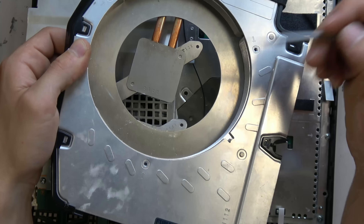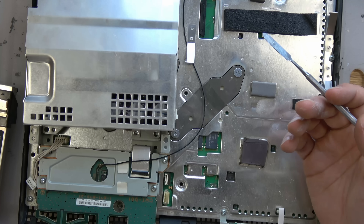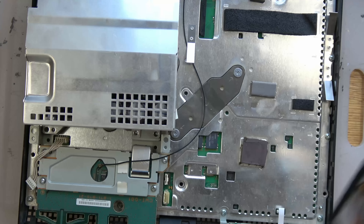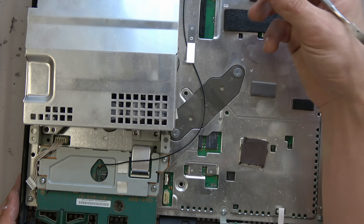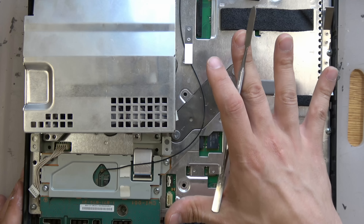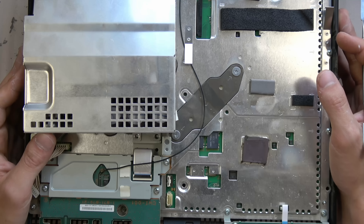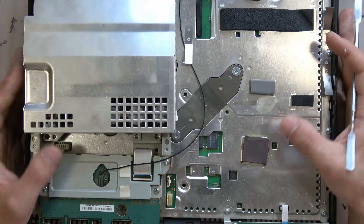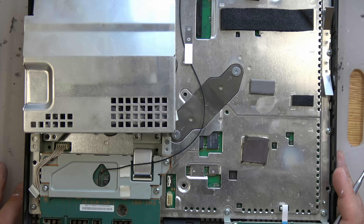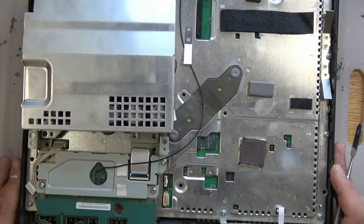For what I do now, I just add a potentiometer to the existing fan so you have manual control and can crank it up. There's a temperature gauge somewhere in here that detects the board temperature and tells the fan how fast to go, but it never seems to work properly — it never tells the fan to go high when it needs to. That's why I like the manual control with the potentiometer. And the biggest thing — the most important: open your consoles and clean them. Having a clean console is very important because dust impedes airflow and creates additional heat. So thank you guys very much for watching, I really appreciate it, and I'll see you guys next time.